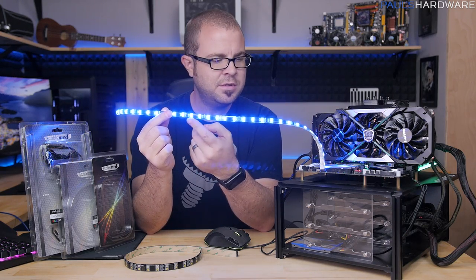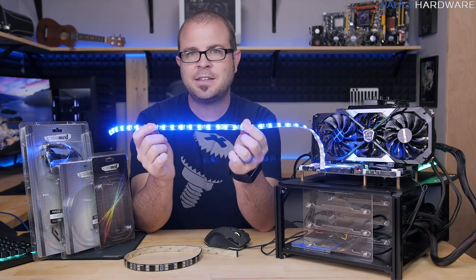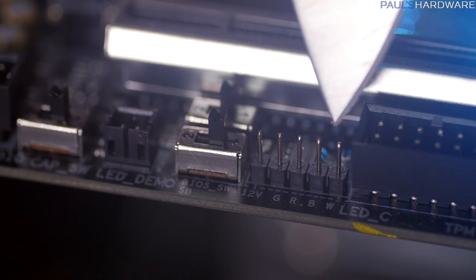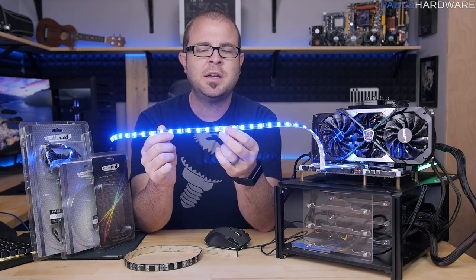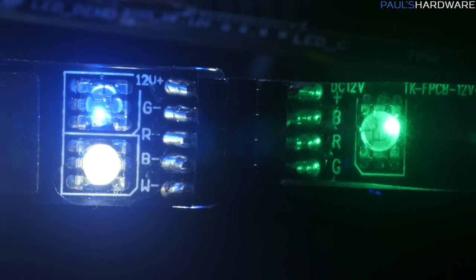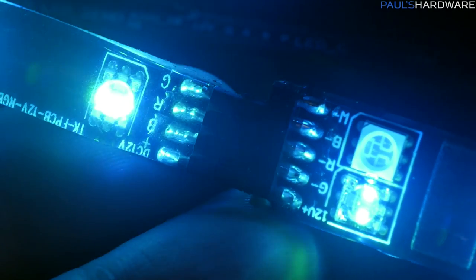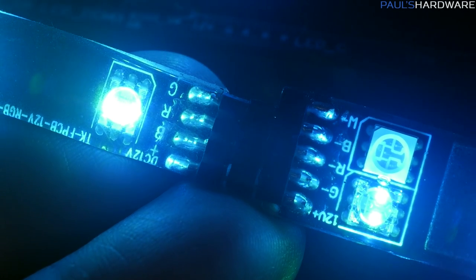What you might be seeing is the LED strip is blue but the motherboard is green — a little snafu you can get into when connecting RGB LED strips. It's not standardized: R, G, and B are sometimes switched or flip-flopped. It won't cause a fire, but just make sure the 12-volt always goes into the 12-volt plug. When channels are swapped, the motherboard says 'make it green' but with green and blue switched, it ends up blue. You can combat this with adapters like the one that ships with CableMod LEDs made for ASUS motherboards, which flips a couple of the wire leads so the motherboard's output corresponds with what the LED strip expects.